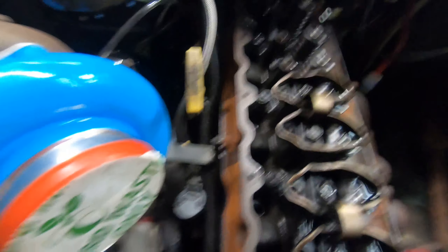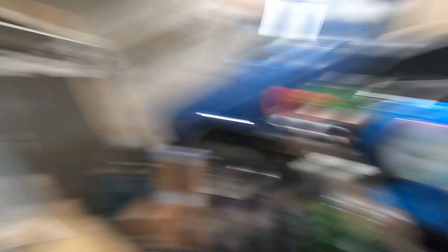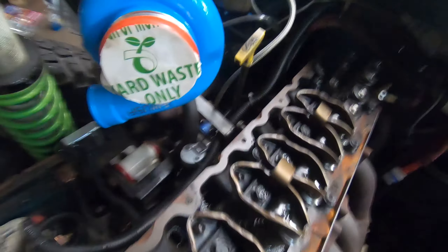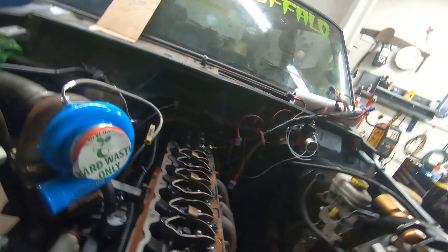Are you ready? As you can see, we got our head dropped in place and we got all our bolts started. Now it's time to torque them. ARP recommends about 110 pounds, but we're going to do 125 in three equal steps: first at 75, then 100, then 125 — following the ARP, Haynes, and Chilton torque pattern, starting from the middle and working our way out.